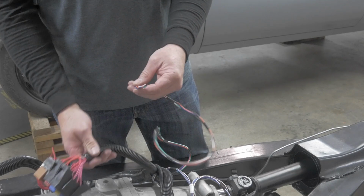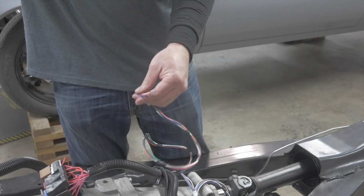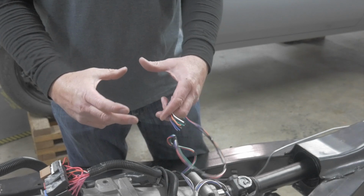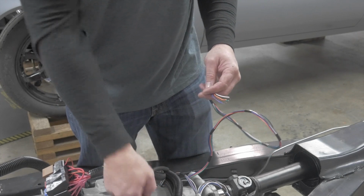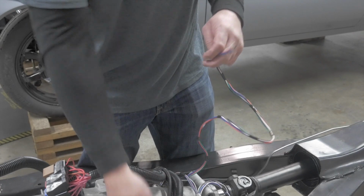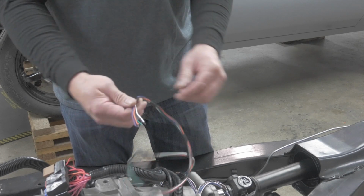Okay, so after your ignition there, we have now these last couple wires, and these you don't have to hook up if you're running a different module. You could run from Dakota Digital Gauges. They sell an OBD2 module if you want to go for super simplicity. It's about $100. It will plug right into your OBD2 port, and it'll give you all the signals you need for your coolant temp sensor, for your oil pressure, your mill light, everything. So if you're not, PSI also provides you with it.